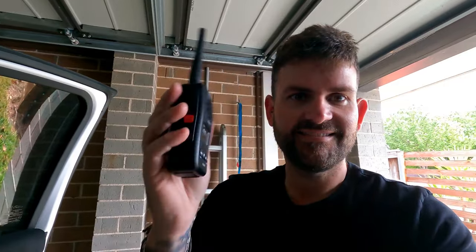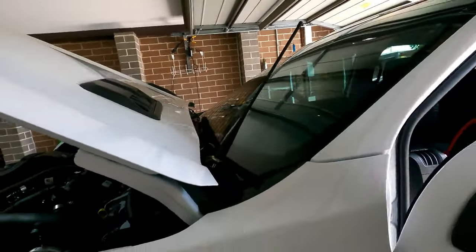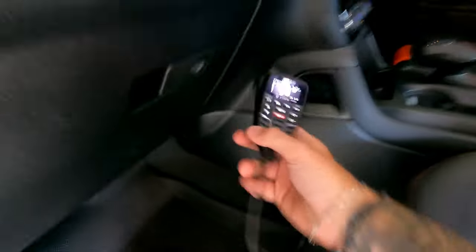Let's see if it works — can I get a radio check, please? Maybe everyone's got their radios off. Backup plan — handheld. Copy, copy. Perfect, it works! There you have it — the 2A all done and dusted in the Ranger Raptor. Pirate Camp Co bracket, tiny little RFI aerial, sleek bonnet mount, add-a-circuit in the fuse box, handpiece mounted out of the way. Everything works as it should. Anyone could install the 2A — there is literally nothing to it. Everything nowadays just basically plugs and plays.